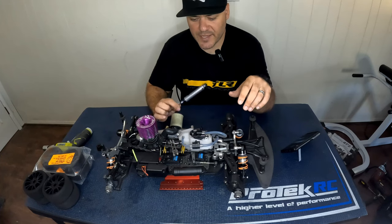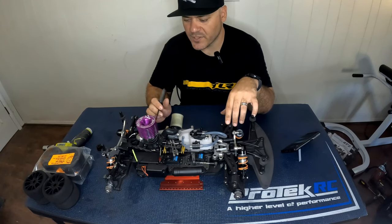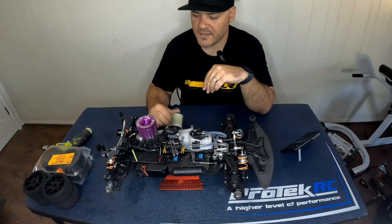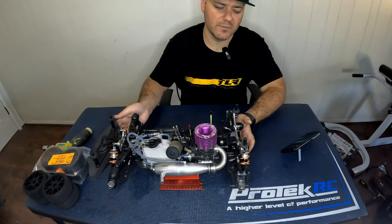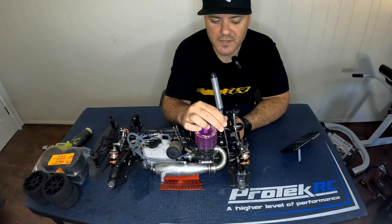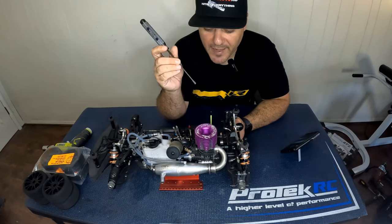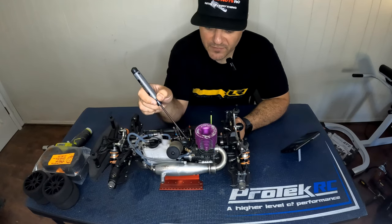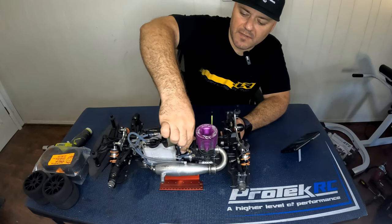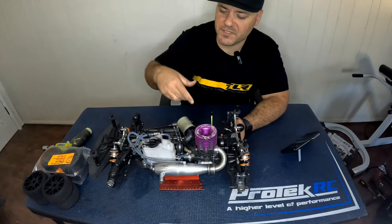I don't know. Yeah, so you get your clutch, of course, and your flywheel. That's included with the kit. So you put that on your engine of choice. And then, of course, you need an exhaust. I did run into some trouble. Some exhaust manifolds are so big that they almost touch the sway bar link on here. So again, you're going to have to play with that. No air filter. I'm just using this TLR air filter, which is actually turned around the other way. So yeah, TLR air filter fits perfect.